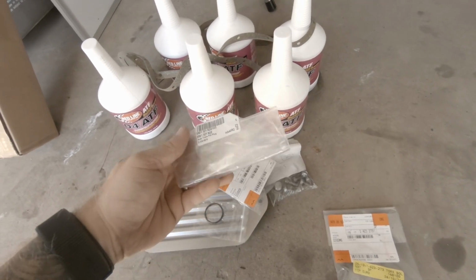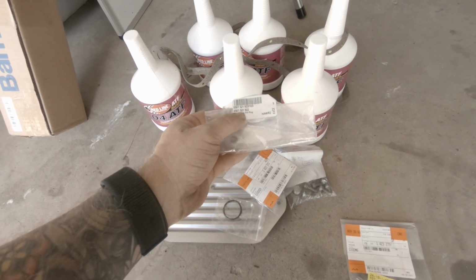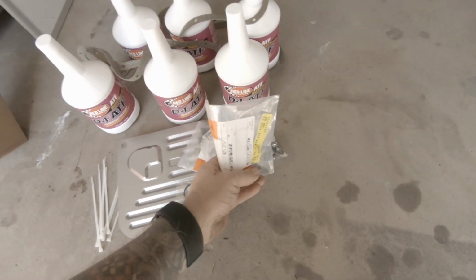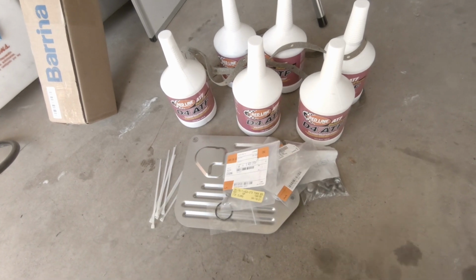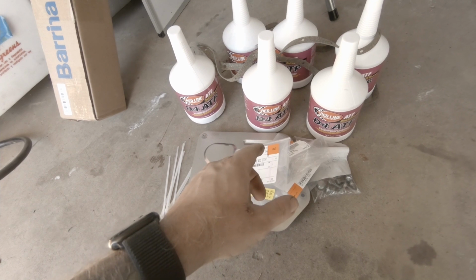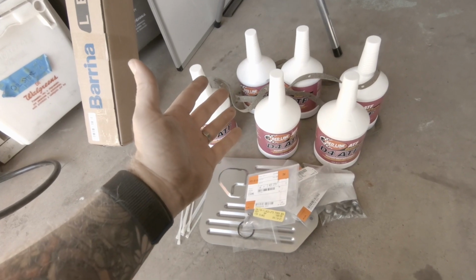We also got 2 drain fill plugs, one of course for the drain, one for the fill plug, and that is the number 0501321922. You just need 2 of those guys, and then of course I think it was 22 of the bolts. They missed one. But here, let's go ahead and we'll drain the transmission. We will start dropping the pan, and as we're doing that, let's talk a little bit about the approach of fill or flush. That's the question.